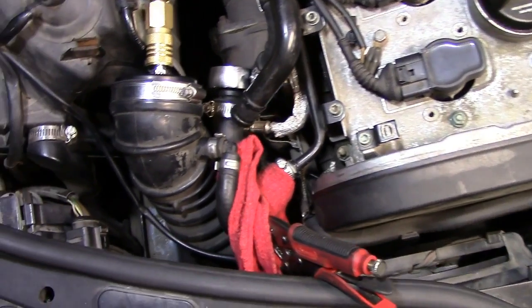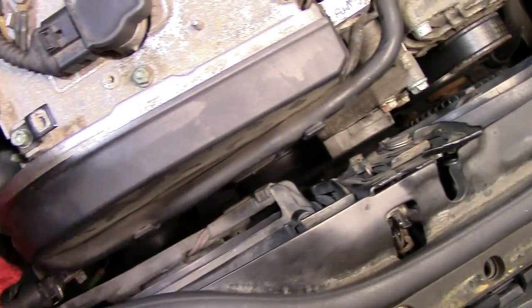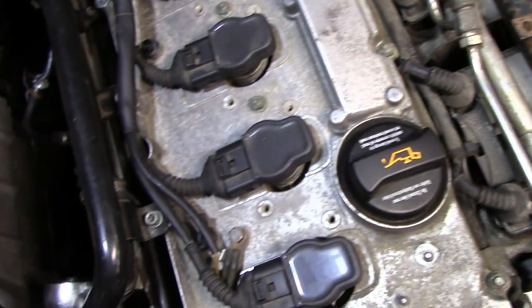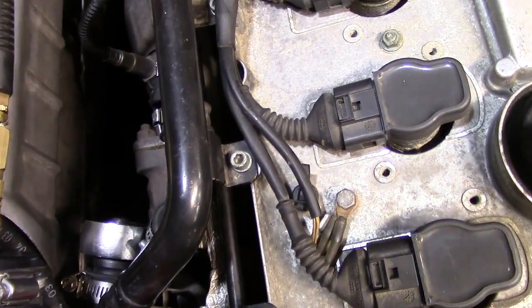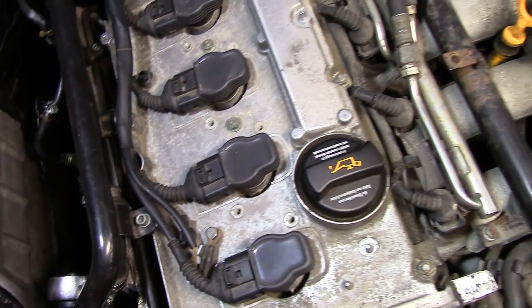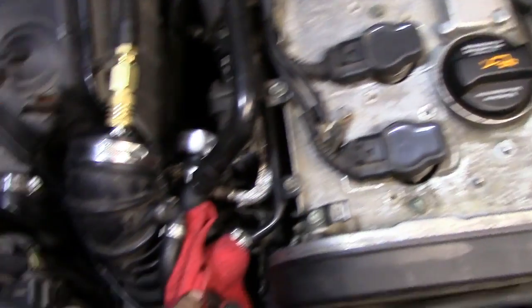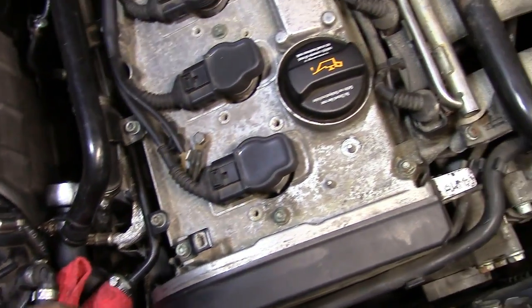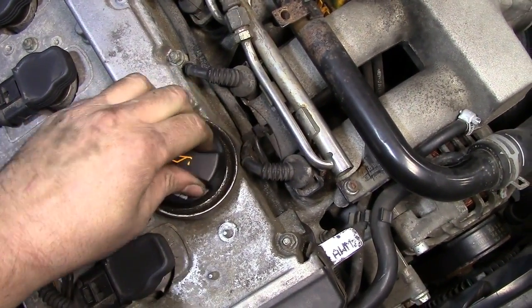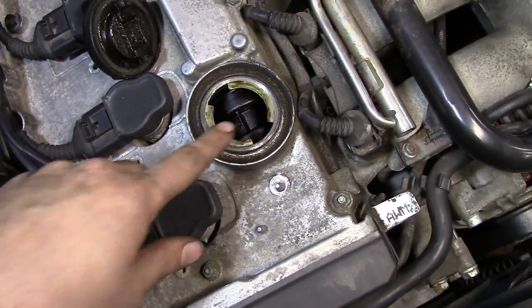Now listen for hissing noises. If you listen closely you'll probably hear two things: first, the sound of oil churning — some of this compressed air seems to be making it to our crankcase and pressurizing it. So just to be safe, open the oil cap to let some of that pressure out — it's not excessive, but you want to be on the safe side.